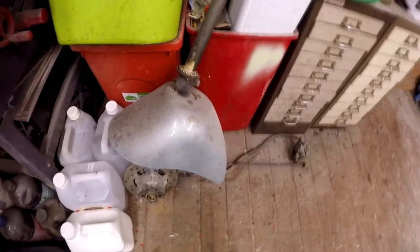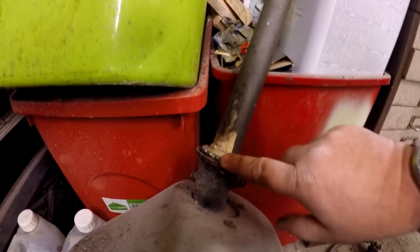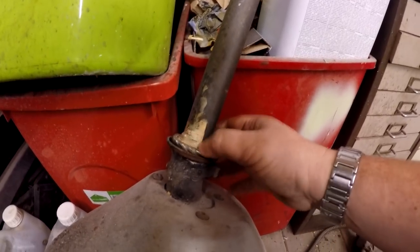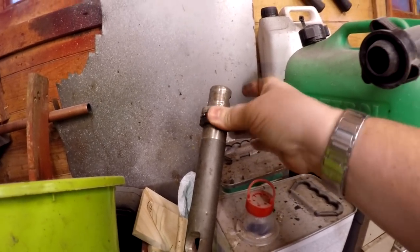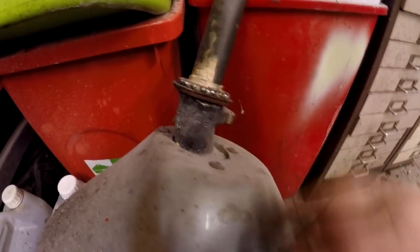I've got to take this front mudguard off of the Piaggio. We've also got the bearings to put on at a later stage. This happens quite a lot with older motorcycles that have been standing for a long time — you can't rely on the grease to be lubricating as it should. As you can see, the grease has all gone solid in these old bearings. We've got to take these off the shaft and put new bearings on, along with the new bearing holder caps at the bottom.